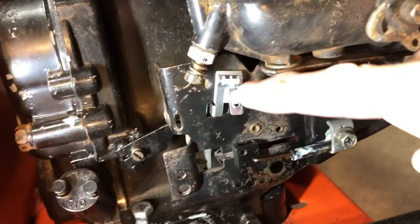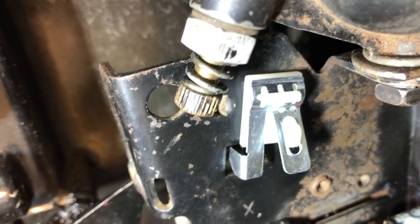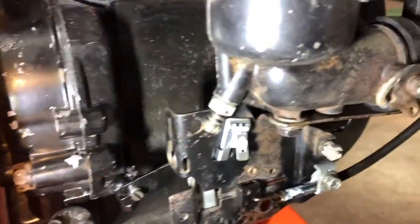There's where that thing snaps in place. Now when you work the throttle, at the off position it shorts right there. Now I have to figure out where the wire is. I swore when I had the blower housing off, I had an ignition kill wire on this engine someplace.